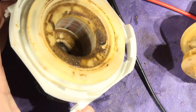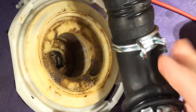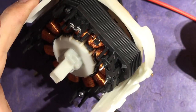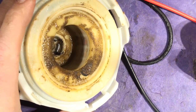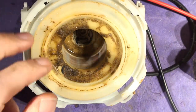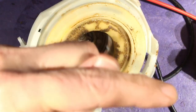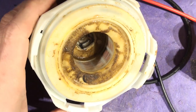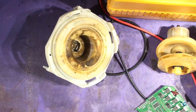We ordered a new pump and I'm confident that will fix it. It's very easy to get apart - just a load of screws, pull the clips back along the pipe, and it comes out easily. They call it a circulation motor on many sites. I'll put up a part number in the description so you can check if it's the one used in your machine. Such a shame that a small failed bearing caused the scrapping of a whole pump. Hit the subscribe button if you're not subscribed, and leave a like if this helped you diagnose your Beko machine.